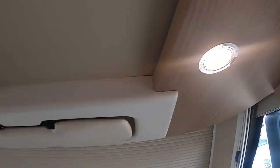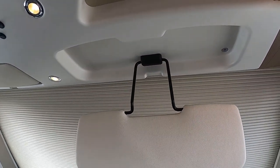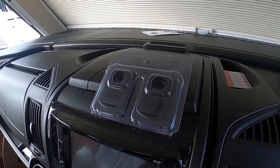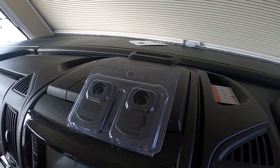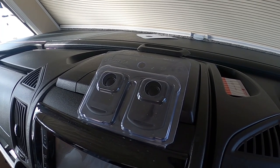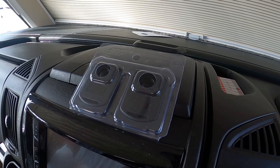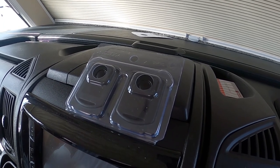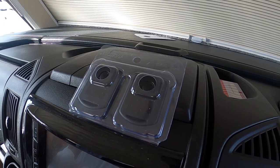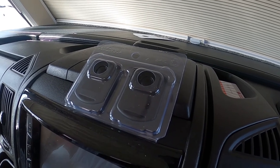Above you've got all your lights for under your bed area, and your visors which come down like that. This customer has also had a tracker fitted. These are what are known as driver's cards — whoever drives the vehicle must have one on them, otherwise the tracking system will alert you thinking the vehicle has been stolen. Don't put them on the keys; if somebody steals the keys they'd have your driver's card too. Keep one in your wallet or purse so it's always on you. If you forget the card, you'll have to stand the tracking system down.